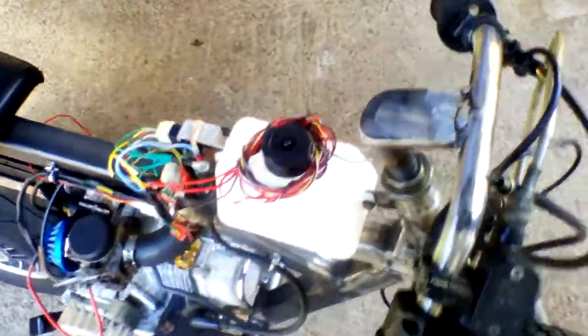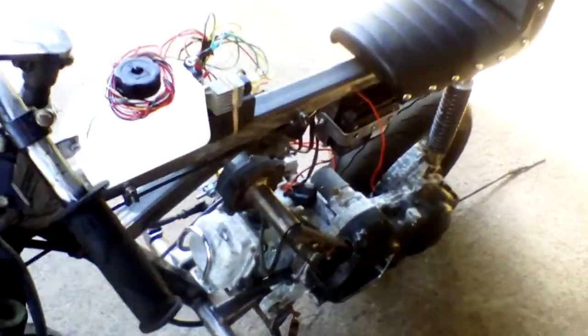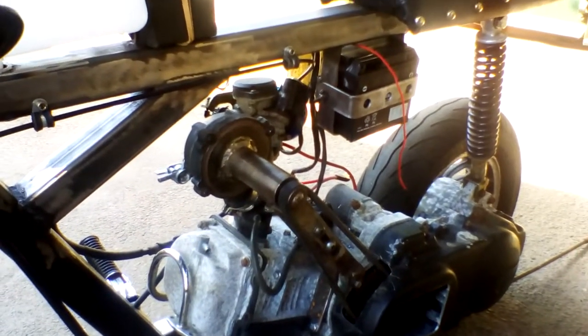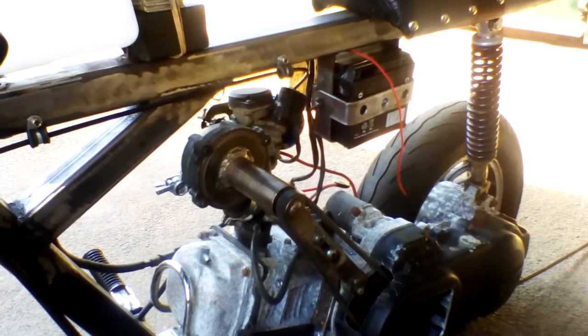This is something I've been wanting to do for a while, but all my bikes are two-strokes. You can't conventionally supercharge or turbocharge a petrol two-stroke engine without some kind of valve on the exhaust — it's just not going to work.